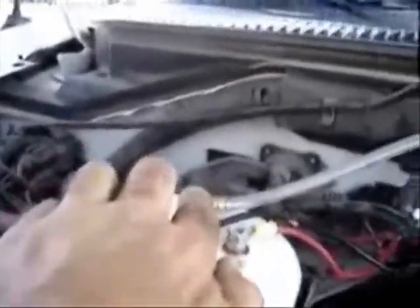The cap on the top here is your fill cap, where you use a funnel to fill it. And your power wires — negative, positive — and your exhaust line go across here. We follow the exhaust line and our wiring goes across to the unit, and the wires go out through the fender well to the power box.